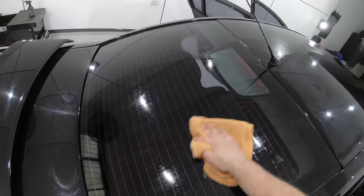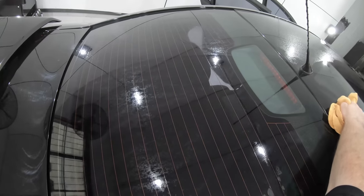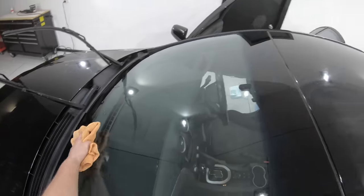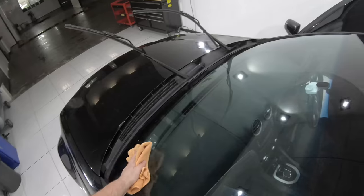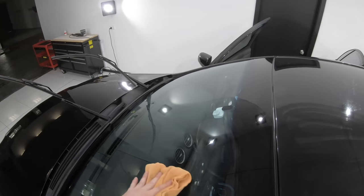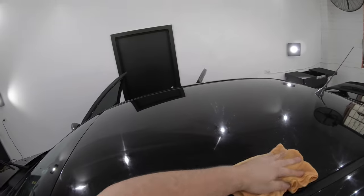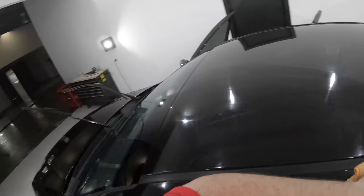Now, in saying that, IPA panel solutions can certainly cause issues of their own, such as increasing the likelihood of wiping swirls and sometimes hazing car paint, which is almost always directly related to using them on soft and sensitive car paints. Now, I'd say on 80 to 90% of cars I work on, this is never an issue, but on that other 10 to 20% of more extremely soft paints, it can certainly be quite a frustrating issue to reintroduce swirls and haze after polishing the paint.